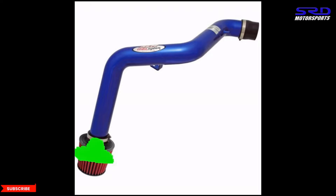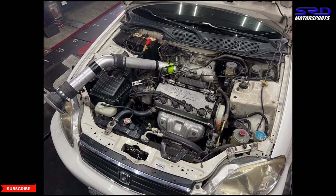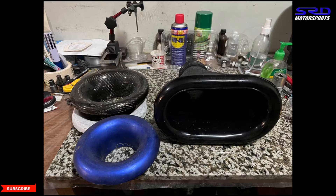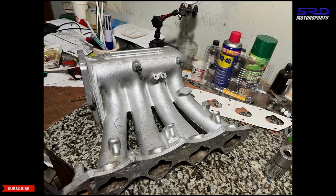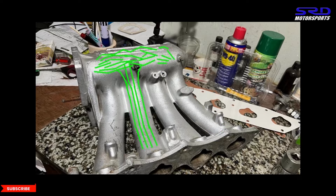The length of the cold air intake helps stack air into the plenum. Even if the piston is in the compression stroke and the valves are closed, this stacks more air into the plenum, filling it really well. That's why on the dyno we see a velocity stack giving more power — even Jasper's EF that runs 12 seconds uses it. The video and the ram air we designed are linked in the description, along with data logs on why we develop such things.